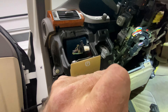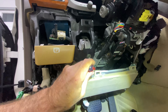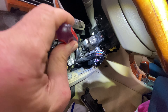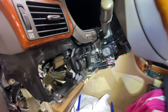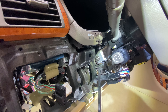Now I've got to explore the steering column and see if I can find the motor. I may have to take this off. This is an airbag — I'm going to have to take this bolt and this bolt and then drop it down to gain access. I believe this is the tilt motor, and this is the motor back here that runs the telescopic motor.